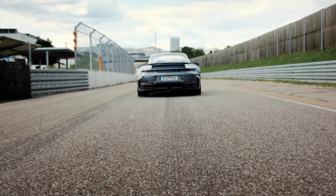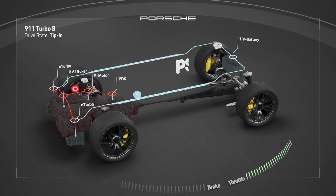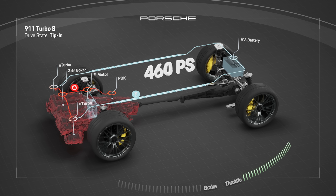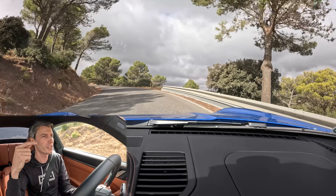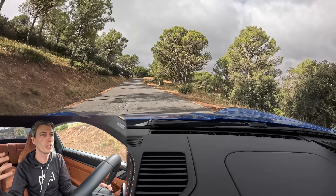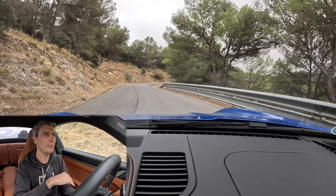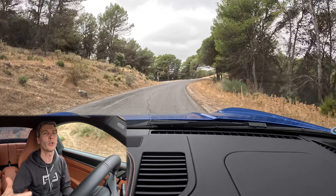So in this car, when you get in the right gear and get on the gas, the initial feeling of acceleration is all coming from the engine — from that boost, from the turbochargers being spun up so quickly by the battery. The launch strategy is the same: if you put both feet on the pedals and release the brake, first those turbochargers spool up to max boost as quickly as possible so you get max power from the engine. Then those turbochargers start sending energy back to the traction motor, because you're setting your boost limit via recuperation — using them as a brake — and if you have additional energy from the battery, you send that to the traction motor for maximum torque and power.